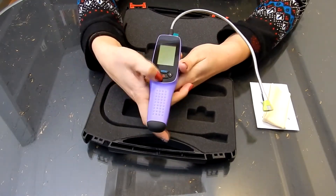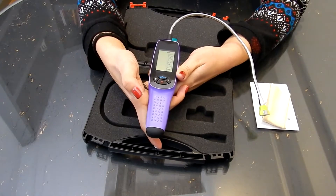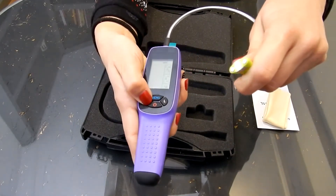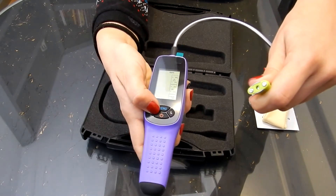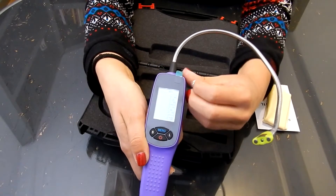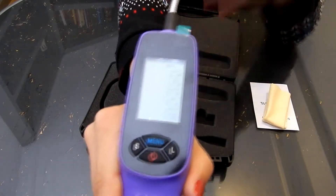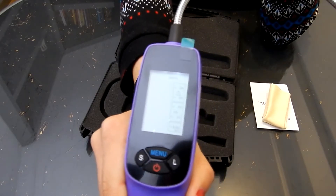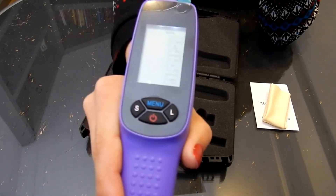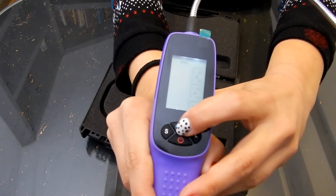So how does it work? You press the red button to turn it on, then press the S button to turn on the light for the probe, and the L button turns on the light on the screen. On the screen, less than 0.05 means no humidity or low battery; 1 to 2 is okay; 3 to 4 means the fluid needs to be replaced. The menu button switches between dot 3, dot 4, and dot 5.